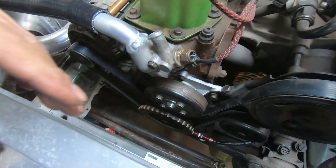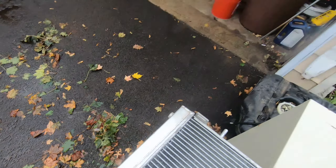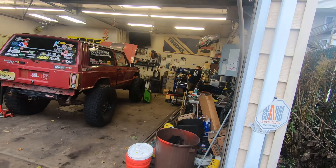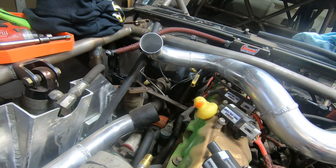This is going to come off again — I've got to figure out a fan setup. I was playing with the radiator and it's not actually new; Jeff donated it to me after he put a 4.8 in his Jeep. He had the old Renix motor in there, and it has that sealed cooling system. He liked to rust it up, so I'm trying to clean that thing out and get all the rust out before I send it through my motor, which is fairly clean inside. While that's sitting there flushing, I want to start putting the turbo back on and figuring that stuff out.